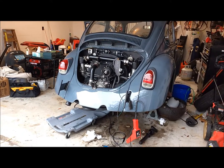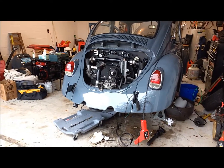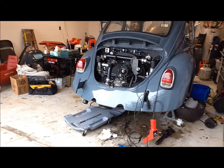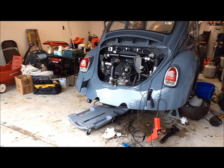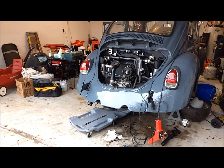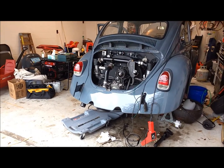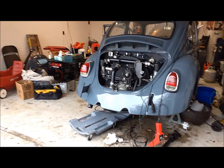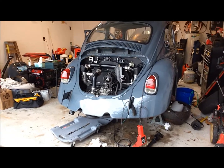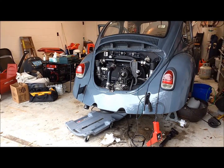His truck has the ethanol sensor in it. Have you seen how much it takes to get that ethanol reading up? He'll drive his truck down to a quarter tank, fill the whole thing up, and the gas stations say it's E85 but sometimes it's like E30. He'll fill it all the way up with gas, run it all the way out, and end up with E60. You've got to have a tune for that. A separate fuel cell with a dedicated setup would be simpler — more money, but simpler.